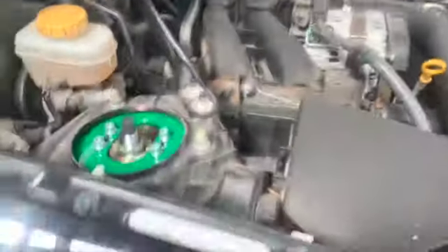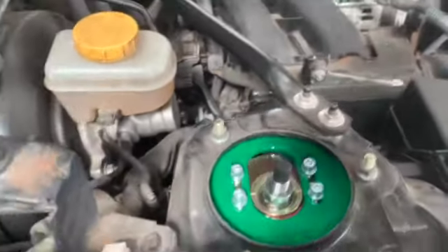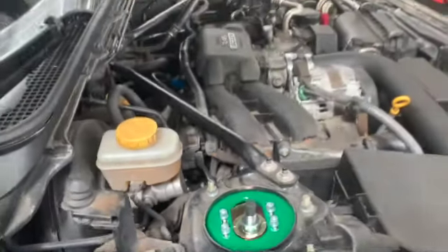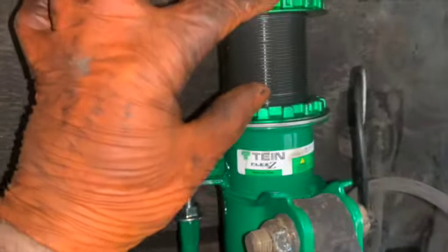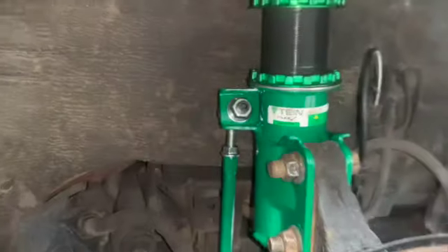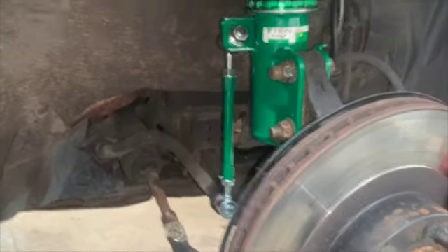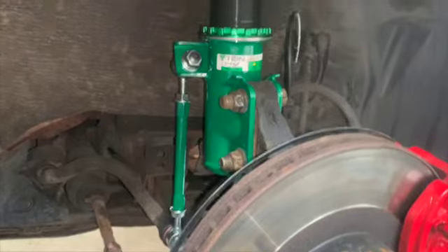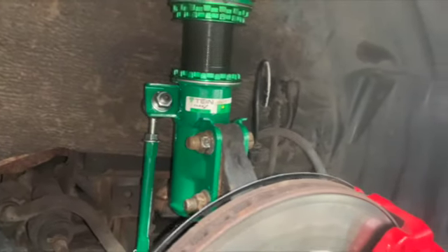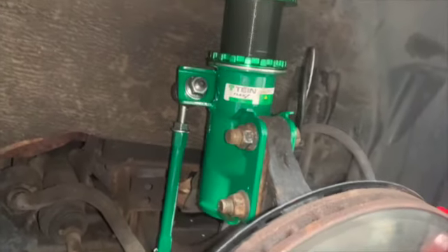We've just literally whacked the coilovers in, tightened up on the three bolts on the top each side. We are doing a laser alignment on it after, so we will talk you through that as well. I need to speak to the customer about what he wants in terms of camber and toe. We've adjusted the coilover up a little bit because I reckoned it was going to be too low. The drop links, although they're adjustable, I've set them roughly to the same size as the original ones because we're going a similar height. We'll set those up on the four-post ramp for alignment. Front is complete — just need to double-check, double-tighten and mark everything up, then we move on to the back.